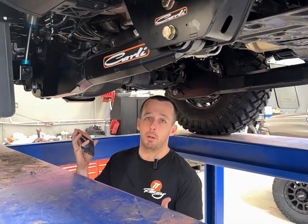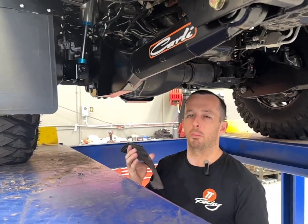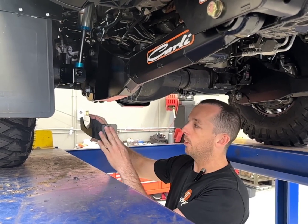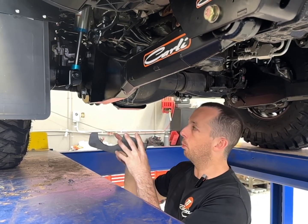What we've come up with — there is another mount on the market that you can cut off and completely weld. This is designed to complement the factory mount without all the cutting and grinding. It bolts on the factory location. When you put your shock in, it bolts in, and you clean it up around the front. This picks up a fair bit of the diff tube also on the side.